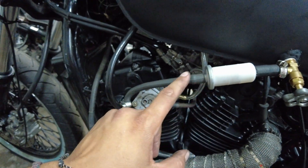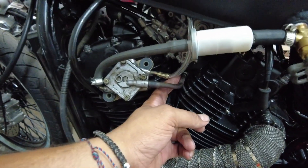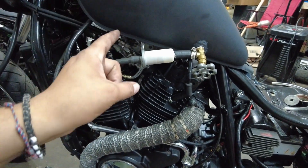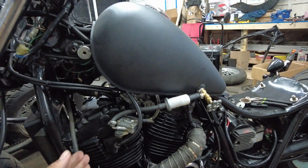You can see the fuel is coming out — it goes in here, then it gets pumped with the vacuum of the motor which is attached back here, and then the fuel rises and goes inside to the carbs. Let me test this out real quick and I'll come back with some results.